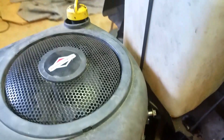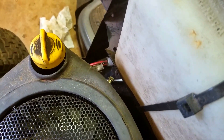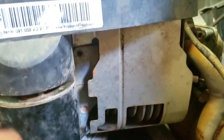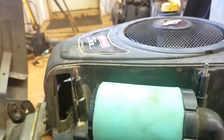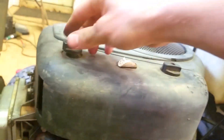Put your plastic housing back on and tighten this bolt, this bolt, this bolt, and this bolt. You're going to want to make sure that this heat shield's tabs are properly on the plastic up there so that it doesn't break anything. Now we can insert our air filter — pop it on here and press it into place — then put our top cover back on and tighten these down.